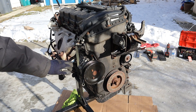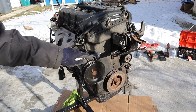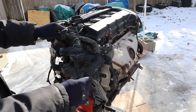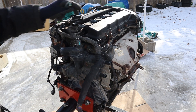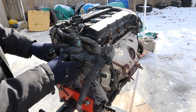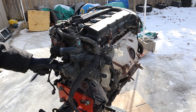Here we've got the water pump which leads to a crossover tube that runs under the exhaust manifold. Under the front of the engine we have a timing chain. Around the back we've got the 4 ignition coils at the top. Then we have this giant plastic coolant manifold that has your outlets for your heater hoses, radiator hoses and the thermostat inlet.